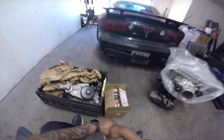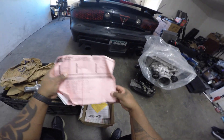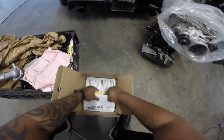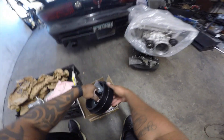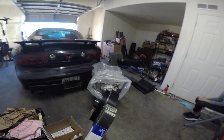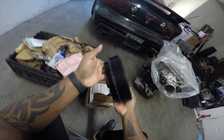I ended up paying $5,500 total — I took a trip to Cali. For $5,500 for everything. And this here, you can see — total $890 — is the wet sump conversion ATI balancer. So I don't have to worry about dry sump; this whole accessory drive will work with the supercharger and the F-body, all thanks to this right here. Brand new — look at this thing — 11-rib. What belt slip? None.